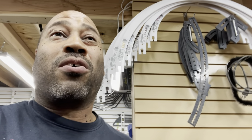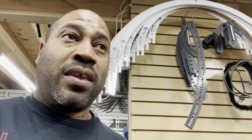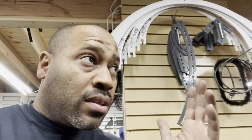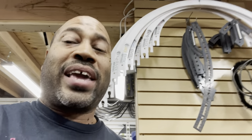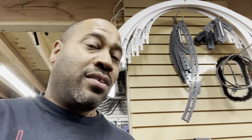I recommend you run to Home Depot and get a crimper, or even the $30 Harbor Freight hydraulic one is really, really good. As long as you squeeze it well and don't deform the connector too much, drop a dot of solder, and use the $13 torch I posted from Amazon — you will have a solid connection that will never, ever fail. If you solder your connections, water will not get in and ruin them. I'll put part numbers in the description below.